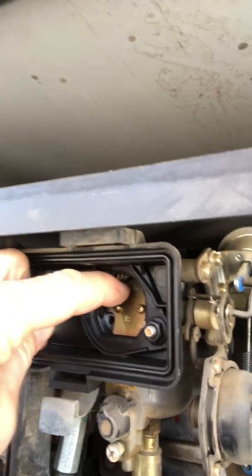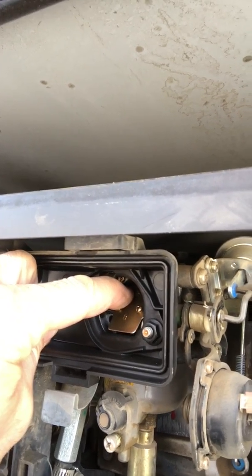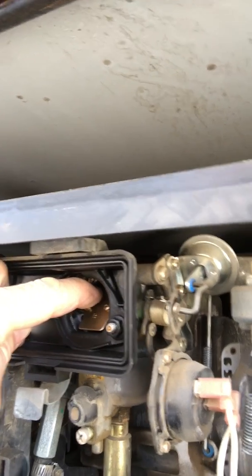Once I switched that after a year of messing around with everything, I noticed when I held the choke open, as soon as it started, 1/4 inch, 10% or so, it stayed running smoothly. So I thought, aha. So it is this, easy to change, and it worked very well afterwards.